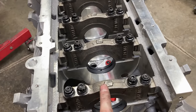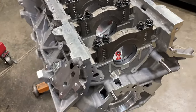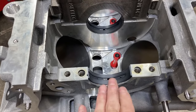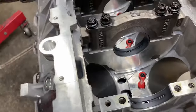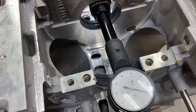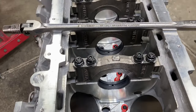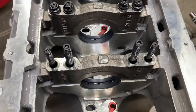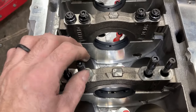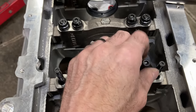Since I've done this one, I'll pop it off and go to the next one. Here's my standard operating procedure: I'll check one, pull the cap off, check the one behind it. We're getting repeatable measurements — 2.2 for number two main. One thing I'll show you is how much room the cap has around the stud, and this will come into play when we're setting the thrust bearing.